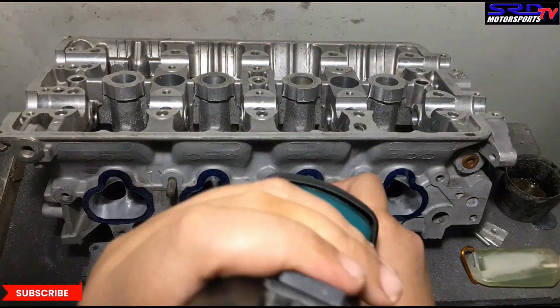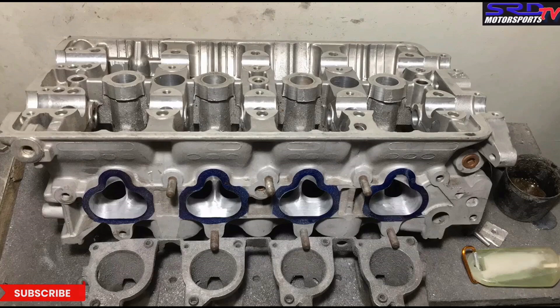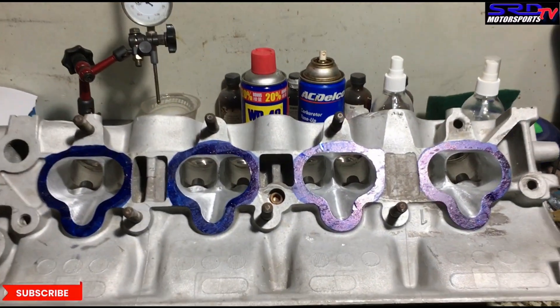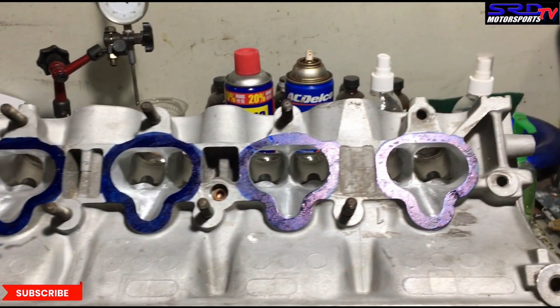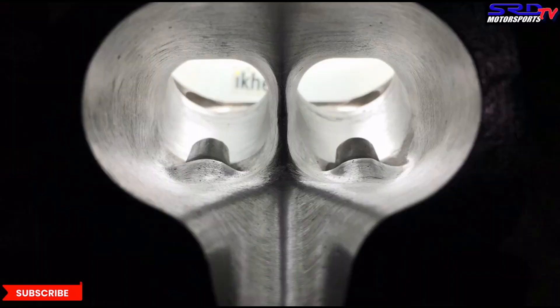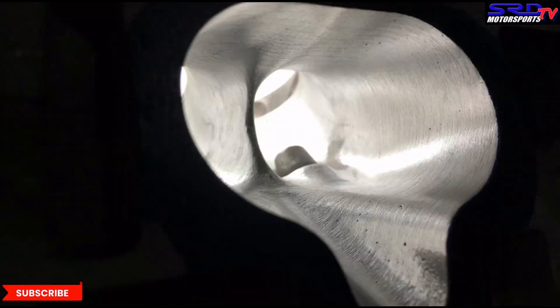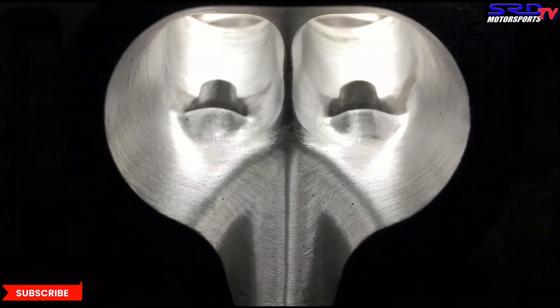This gives you an idea of what we go for in terms of good airspeed. Now on the workbench — it looks really, really good. You can see the transition from the sidewall to the bowl has been consistent and gradual. Here you can see from the divider too. The port floor is actually shaped really well — this is to maintain airspeed. Because if you need more volume, we're actually running Pro 3 cams, so this is going to work really well.